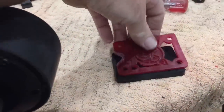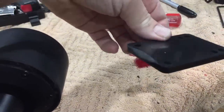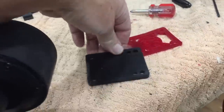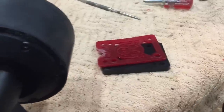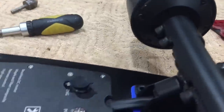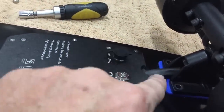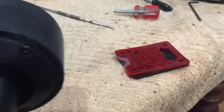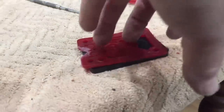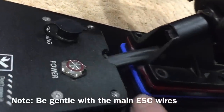Lastly, guys, just take a little bit of a V out of the pig riser and a little bit of an edge. See that? A little bit of an edge on that. So when these go on under there, this cable is not vibrating all the time on a sharp edge. It's got that really nice smooth edge to sit in there. I'll show you when I put it in anyway. Okay, so there it's in now, as you can see, and you've got that little V cut in there.